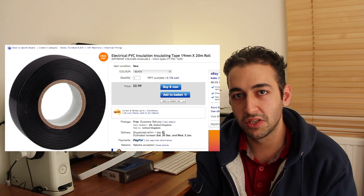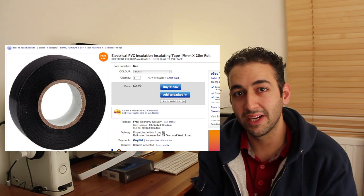I would recommend that the screwdrivers you get are magnetic, so the screws don't fall into the iMac while you're trying to put them in. I'd also recommend some black tape to put over the magnets inside the iMac while you're inserting screws — this makes the magnets less strong. This wasn't in any of the guides; it's something I thought of on the spot because I was getting frustrated. The iMac magnets were so strong that screws would just go all over the place.